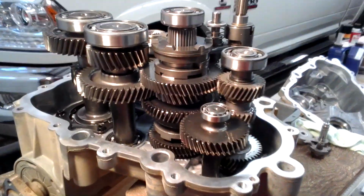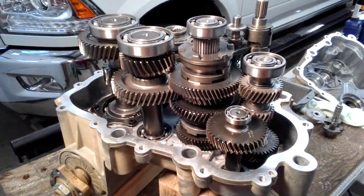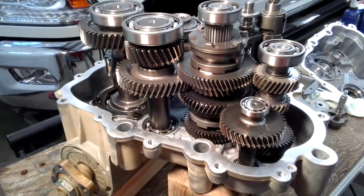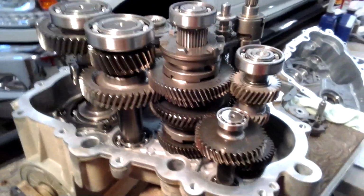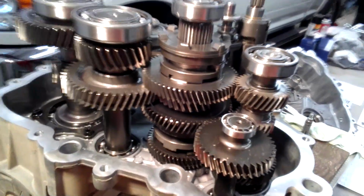But you can buy it. It's just a stock replacement. That's why everybody's coming up with this idea. They call it a 325 gear Ace gear. It's basically the lowest gear ratio that they offer in any transmission. So it works out great to use a stock Polaris gear, so you can order it from Polaris a whole lot cheaper.